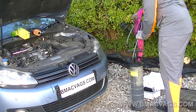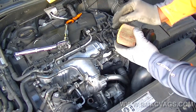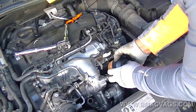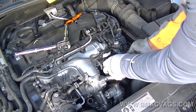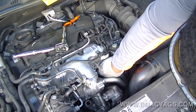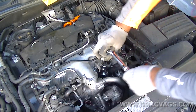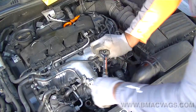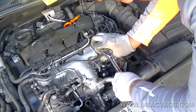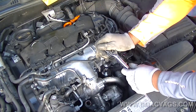You can see how much oil you've extracted, which is always useful. Diesels always need regular oil changes. I'm rubbing a little oil on the lower seal, shimmying the filter housing back in between the gaps. It seems difficult but it does get there. Hand tighten the cap first — don't start cross-threading it with a ratchet — then just snug it up. Remember it's plastic, so don't overdo it or you'll pay the price.